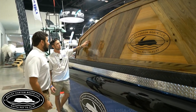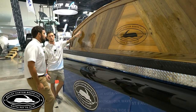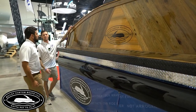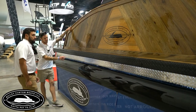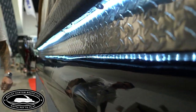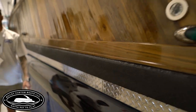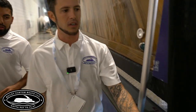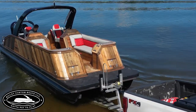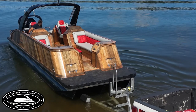The clear coat lasts eight to ten years — it's a two-part epoxy clear coat, same as what they use on jets and the Gulfstream airplanes. As for the paint down on the hull, it's a powder coat on the aluminum hull, with a little bit of clear epoxy on top to seal it in and help prevent scratches and damage.